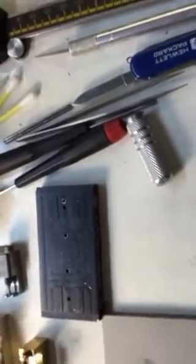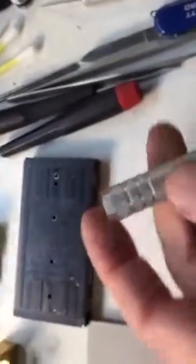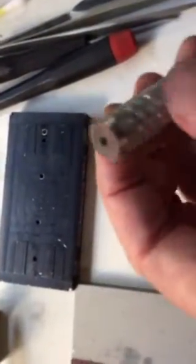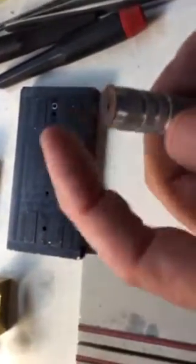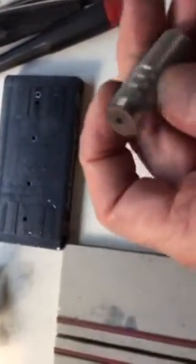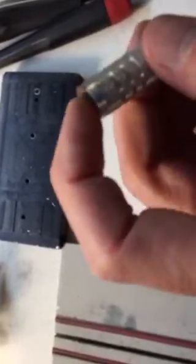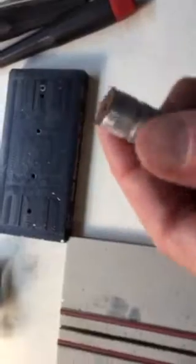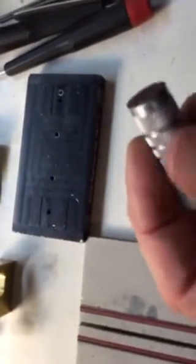Now, another important tool. I'm kind of skipping around a little bit, but this is a COM tool to clean off the COM, and has a sanding disc on top, say an 800 grit that sticks to the top, the hole in the middle to receive the armature shaft, and you just put this on an arm and you can clean up the COM.